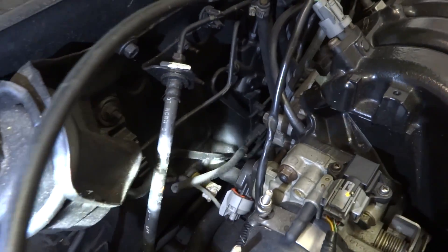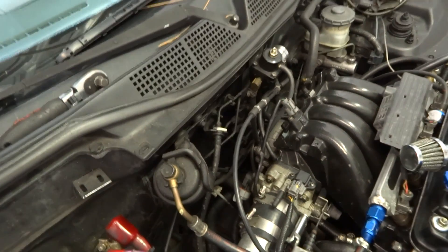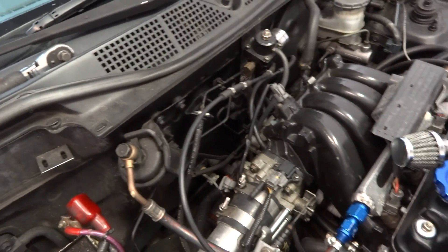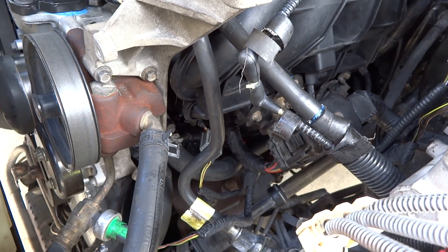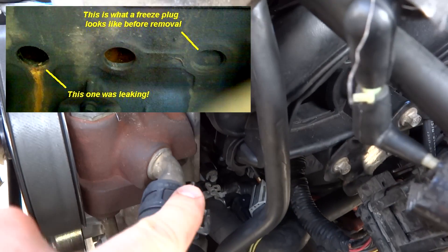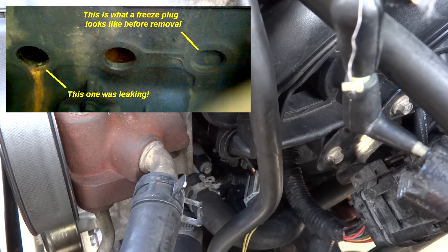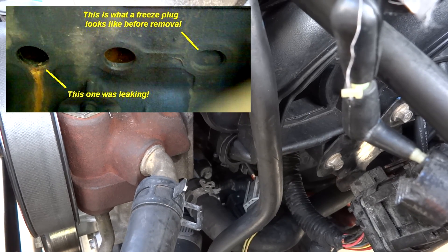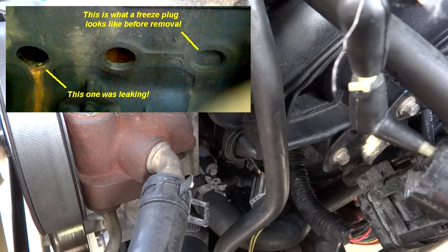Last but not least you've got the heater core. Make sure your heater core isn't leaking — if it's leaking inside the car when you run your air, eliminate that. If you don't want a hefty bill, just cap the lines off and plug them up. Another common problem would be the freeze plugs. On the inside of the block — they're on the back of the block and they look like bottle caps — they tend to leak too. A lot of people use rubber caps: you stick them in there and tighten them down, and they expand instead of using metal freeze plugs. So that's another problem that could be causing it.